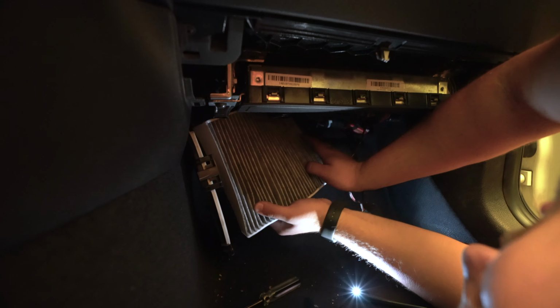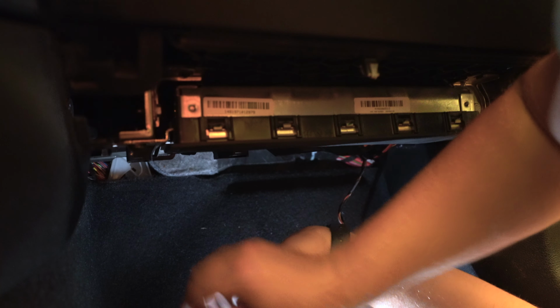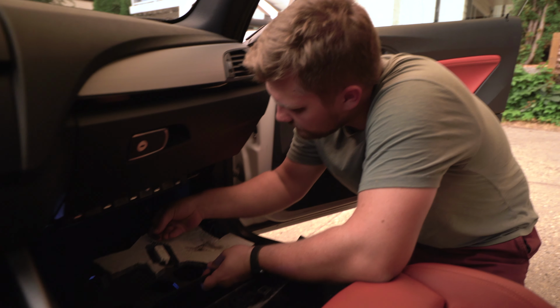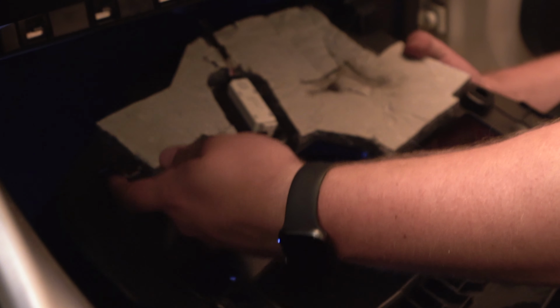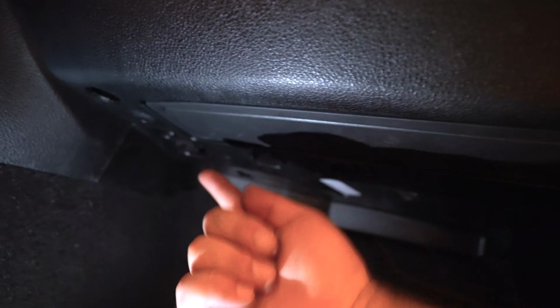And then this. Don't try to undo these wires here. A lot of wires in there. I'm not sure where they go, what it attaches to, but pin here will just go through there right beside the screw. This little tab here pops up into place, and then we just have to put the 2 screws in. Okay, so now I'm just gonna plug the light in here, and you just have to make sure that this goes over the one tab. There's a spot they're supposed to slide over, and same with this. And then apart from that, just pop it back into place. This piece has a spot that needs to slide behind this one right here, so just make sure you get that in nicely as well. But yeah, just clip them all into place, put the 2 screws back in there. After that, you're finished. So that's 2 filters done.